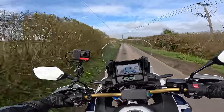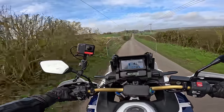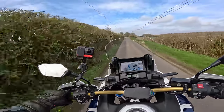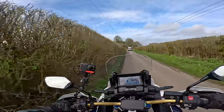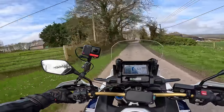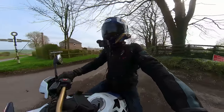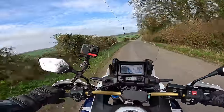This does feel quite different because of the DCT box. We're in top gear already — in sixth at 40 mph, which is quite high. If I hit the sport button, you'll see it's now gone into fourth — two gears lower at the same speed. A big, big difference just by switching to sport mode. It changes down, makes a big difference, but it's almost the other extreme, which is also a little bit interesting.